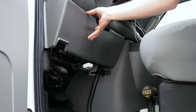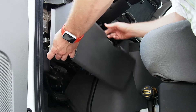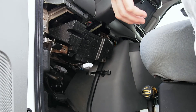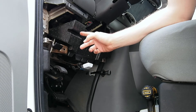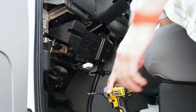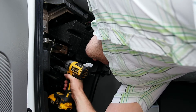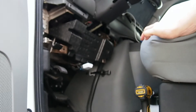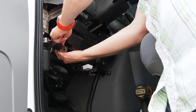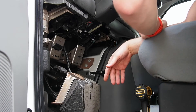First, I'm going to remove this panel under the steering wheel — I put the steering wheel up. They're just little metal tabs that hold them in, so you should just be able to yank on them. This is removable with four bolts up under here and they are five-sixteenths. Now that the four bolts are out, you can kind of yank on these two tabs. And then you have, well, not much better access.